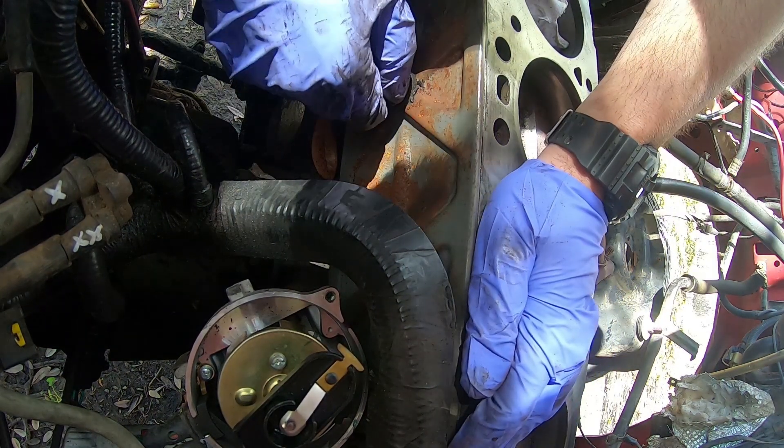It actually isn't bent too bad. Last time I did this, I cleaned the inside off real good, not knowing that I'd probably need to paint this. You see the surface rust. We'll pop all these grommets out — I did a number with that, that's why it ain't leaking no more. We'll get this old gasket off and then we can replace it. The replacement comes with new grommets, washers, all that. And that's what the cork gasket looks like.